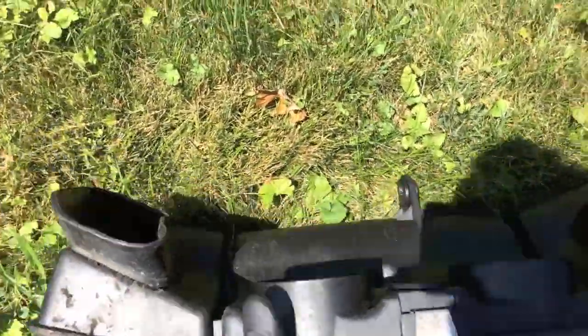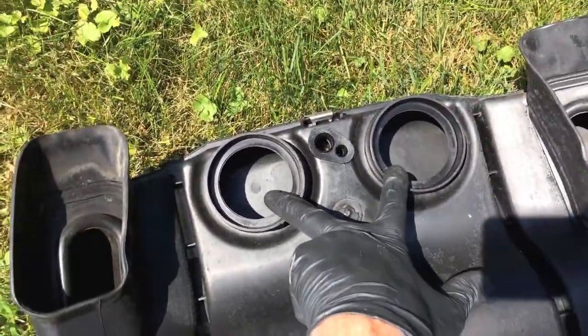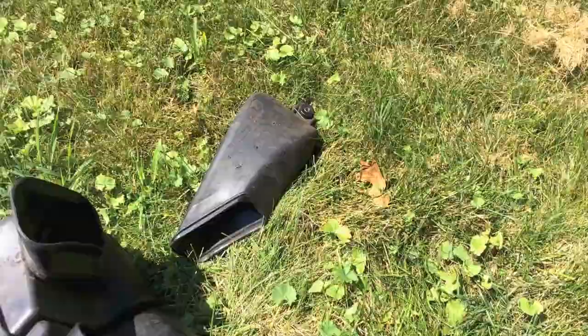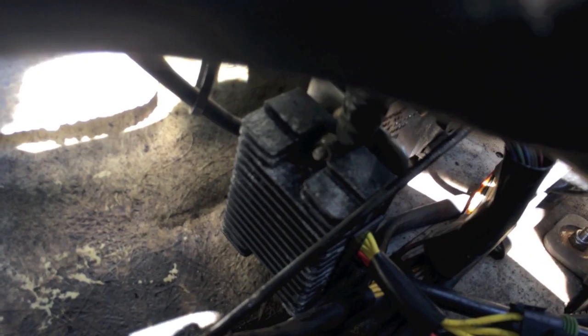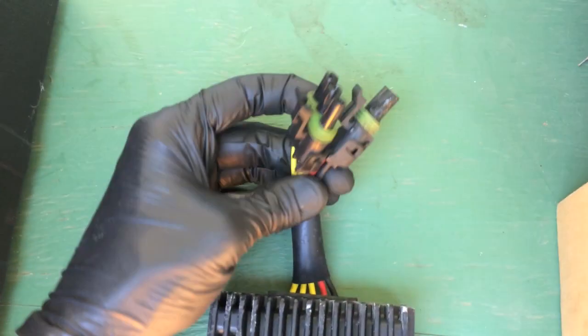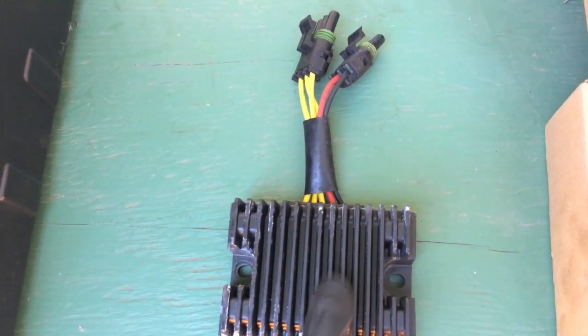The part is now out. There are two little adapters right here that come out, and this portion goes into the engine — here are those two parts. Those fit in here and that's where we just removed that bolt; there's two of them. Now we have a lot more access to the actual rectifier down below as you can see. On top there's a 12mm bolt and on the bottom is another 12mm. If we did not remove the part we just did, it would have been literally impossible to get to that bottom bolt. Go ahead and remove those and you can pull this whole rectifier out and off the mount. Rectifier is now removed — here's the old one; the new one just came in the mail. Here are the electrical connection points we removed earlier and the locations where the 12mm bolts lock this into place.